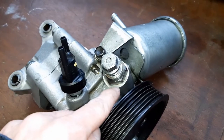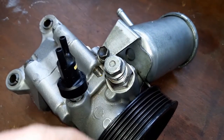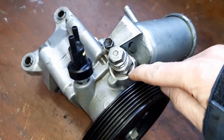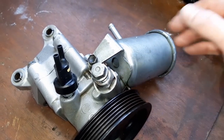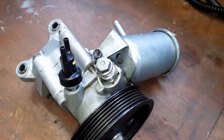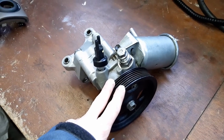I took the power steering pump off to make sure I didn't screw up during the rebuild. I took the back plate off and looked inside, but no mechanical damage or signs of wrong assembly were found. What I did do this time — which I didn't do in the rebuild episode — is take out the element that houses the pressure regulator. That nut was very, very tight, so I used an air impact gun and managed to get it out. It was very tarnished, so I assumed something may have been stuck in the pressure regulator, causing the flow to go in a loop and preventing the system from being bled.